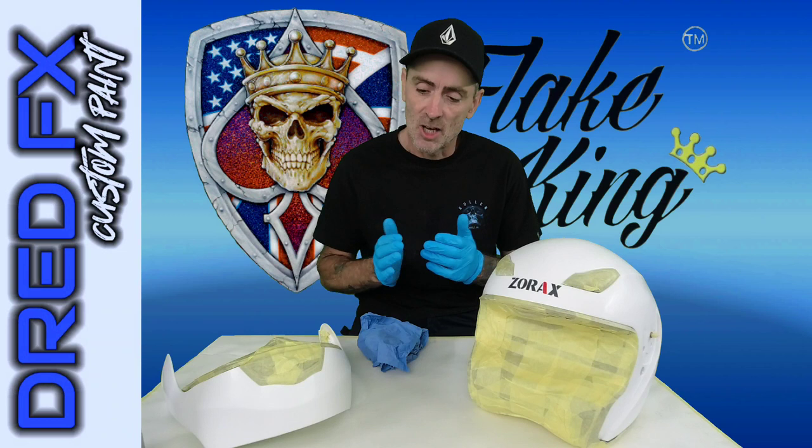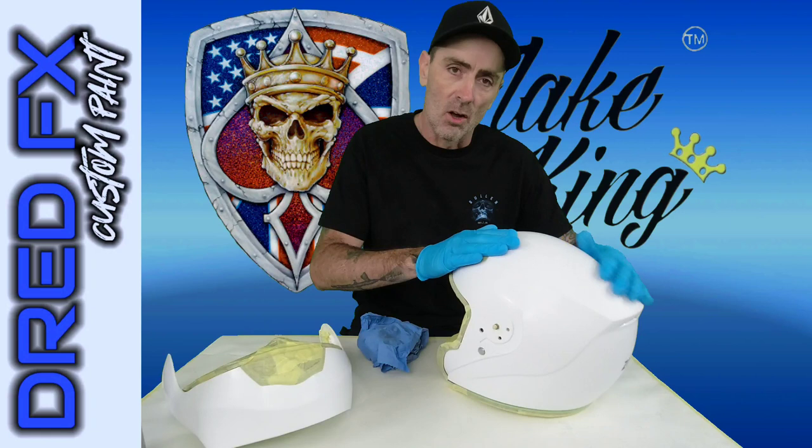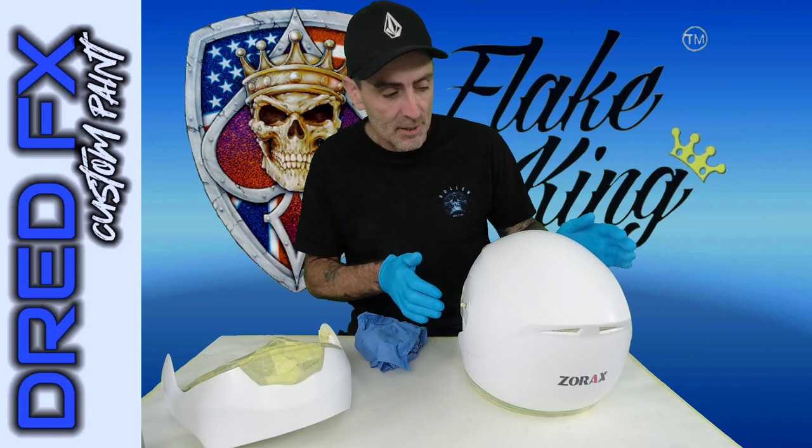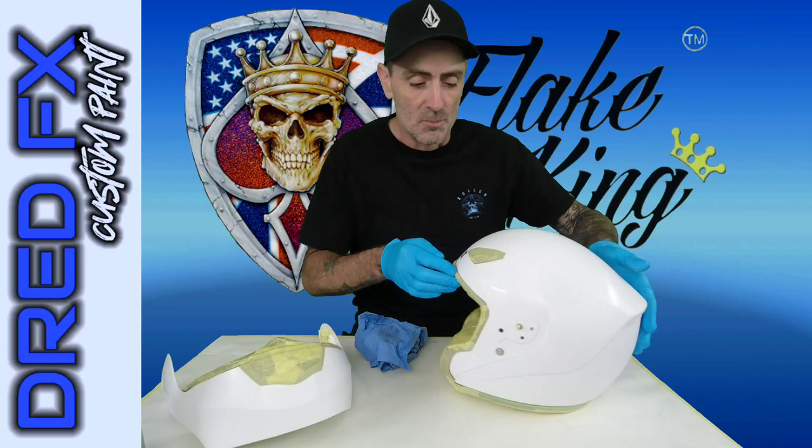There you go, in that last time lapse I've gone round with the grey Scotch-Brite on all these pieces. Now the white round this lid is all dulled off, and we've knocked that gloss off the panel, which gave that a good key all round. It's now a good time to have a good look at your pieces and double check your masking round, because you've Scotch-Brited up to these.